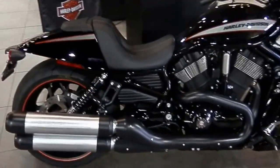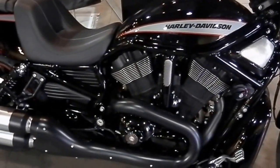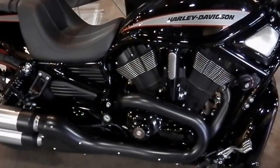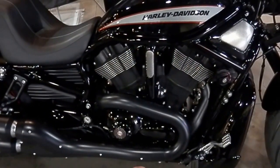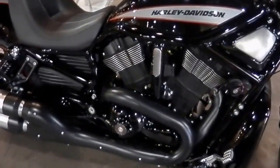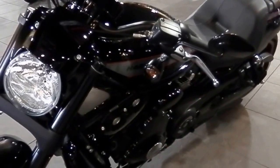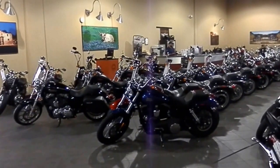We're going to leave you with one last machine — this is the Harley V-Rod, liquid-cooled. It's not a Harley-designed engine, by the way; it was designed primarily by Porsche out of Germany — yes, the same car manufacturer. The main thing you have to look at with this particular bike is that the valves must be adjusted periodically. In order to do so, you have to drop the engine out of the frame — they cannot be adjusted with the engine in the frame, so it's a very costly procedure. If you have or are considering a Harley V-Rod, calculate that into your cost. It's built around really a racing engine as opposed to a street bike, though a lot of people use them as street bikes, of course. This is Caliente Harley-Davidson in San Antonio, Texas.